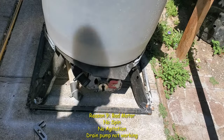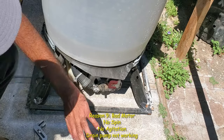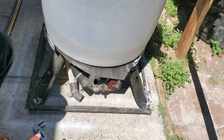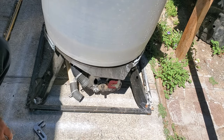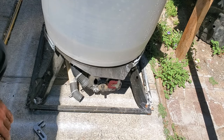The last reason your washer won't spin is that the motor itself is bad. Obviously, if the motor is bad, it's not going to spin nor agitate. I'll show you a quick method I use to test the motor. Basically, I bypassed the lid switch, and I'm going to pull the motor out of the machine, put it on the ground, and test it.